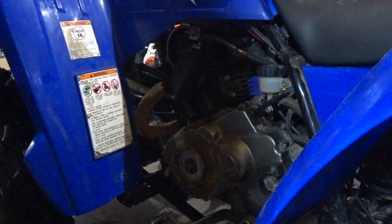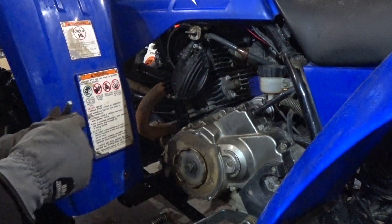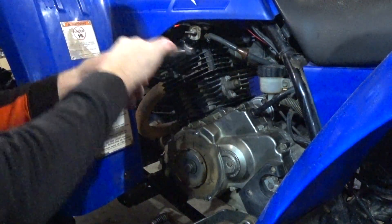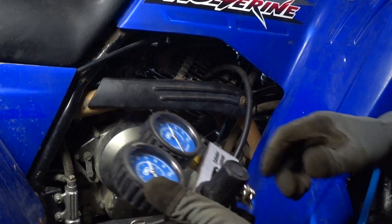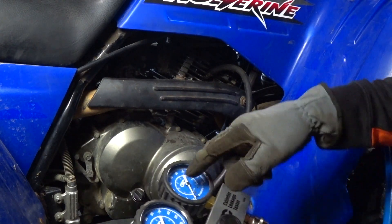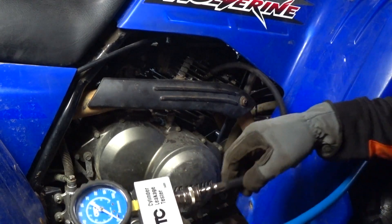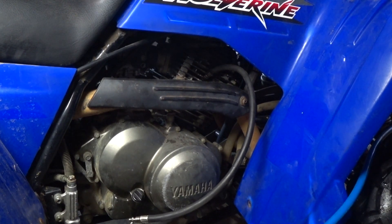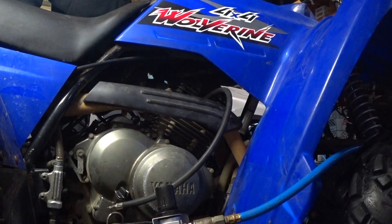Let me grab a Sharpie so when you're holding the wrench on, you know where to hold it. This has to go back on. What you do is, this here will let you pull it out to lock it, then you open it — it lets pressure in and feeds in here, and this measures the loss in the cylinder. What we want to do is get a socket on the flywheel and hold it with the breaker bar at those lines — we've got it at top dead center. We mark the lines there. That's convenient that it lines right up on the plastic. Then I want to spray around the cylinder head with soap.